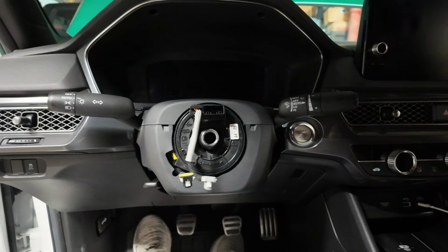And lastly, guys, the last step I can see before we get the new base on and the hub and everything is these airbag resistors. Can you guys see that? There you go, I think that's a little better. But these airbag resistors are gonna go where we remove the airbag, so that way it doesn't throw codes or none of that nonsense, since there's not going to be an airbag anymore.